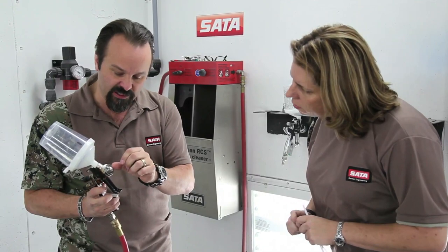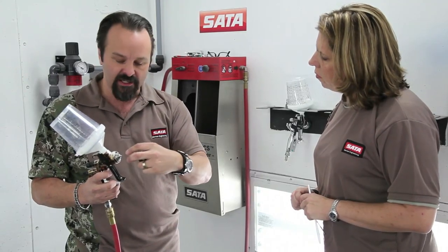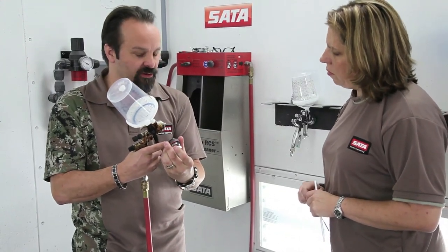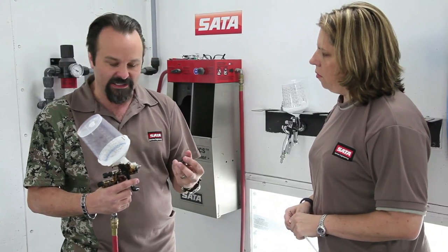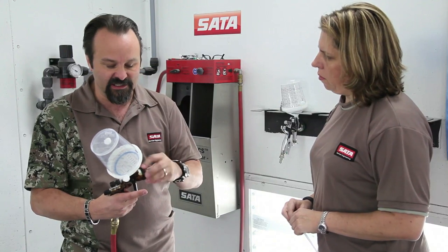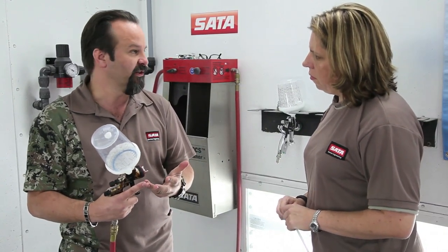Set the gun at 26 pounds, pull the trigger with air, and move in until you feel that wall — it's right about the five-to-six-inch range. That's the ideal spot to paint. On the front of this fluid tip we have a brake plate — a round disc — that lets the air hit the backside and curve around that smooth disc and blow through the air cap without turbulence. It squeezes the air out through the horns and center of the air cap very softly, so I can get in closer without driving solvent into the base or clear coat.